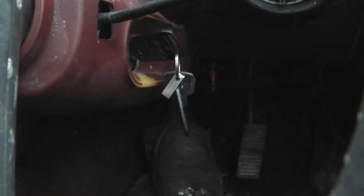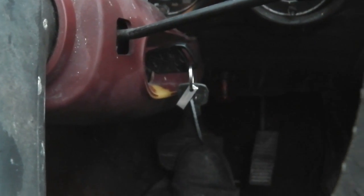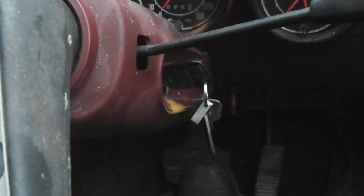We've got brakes as well. Replaced the brake lines. The master cylinder freed off. The seal was a bit leaky on the reservoir, but I took the reservoir off, cleaned the rust up, and replaced the seal, and that locks on and holds the fluid. New copper brake lines on, and the calipers unseized, as you'll see on probably the next video of this process where we do the calipers.